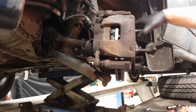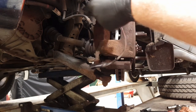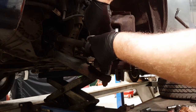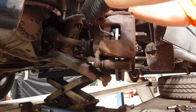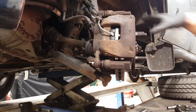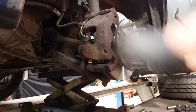Refit the caliper and tighten up with the 15mm and 21mm spanners. Give it a spin to make sure it's all nice and tight. The new bolt that came with the pads is already Loctited. Now refit the brake pad wear sensor wire - push it into the pads and into the nipple, then plug it back in.